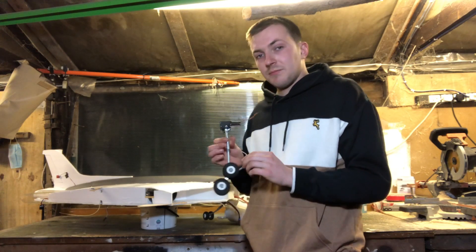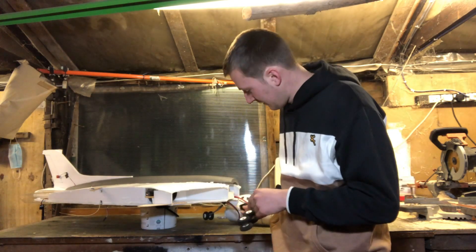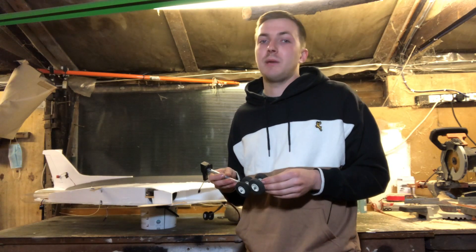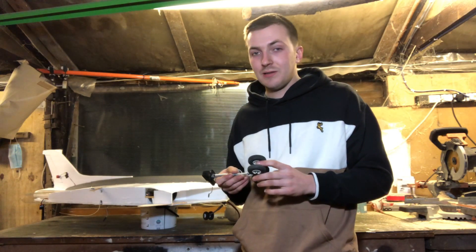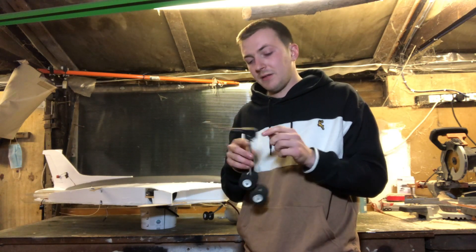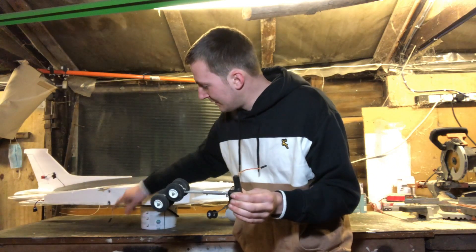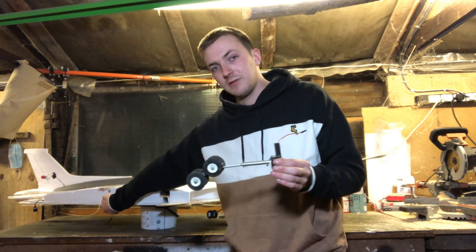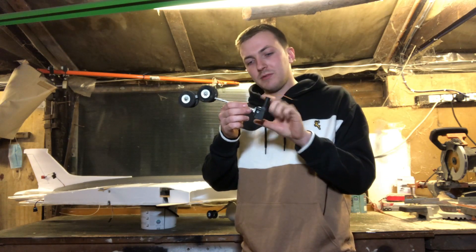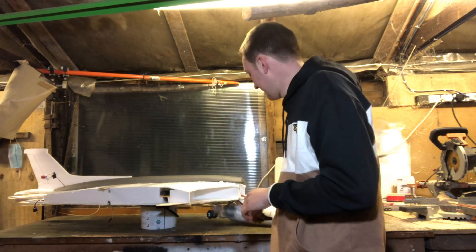Having the rear wheels on the balance point means there is no weight on the nose gear, which is okay since the nose gear is quite flimsy, but when taxiing I was having a lot of trouble keeping it straight and stopping it tipping back. I'm going to have to look into moving the retracts possibly behind the spar. The only problem is the spar will get in the way of the legs when they fold up, and I can't cut into the spar because at the bottom of the spars there's an aluminium tube that joins the wings to the main fuselage. So I may need to have the retract slightly lower, angled back up a bit more so they possibly miss, which just means having these out slightly further — I'll have to play around with that.